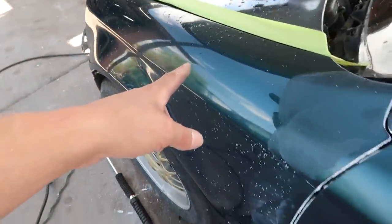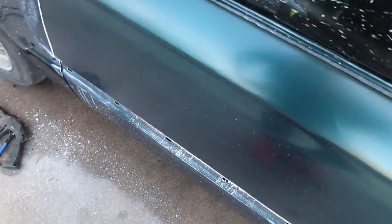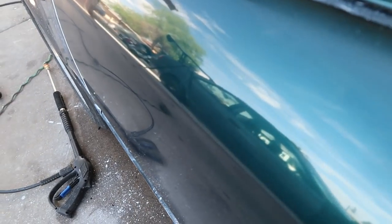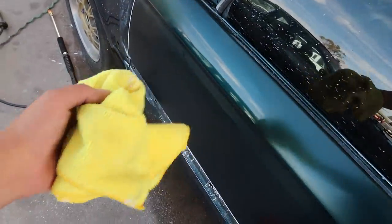So before I move on, because I've gotten that fender done, I went over it twice, and you can see how shiny it is. And you see this isn't as shiny, but I went over this twice as well, that's just because I haven't given it a good old rub down, you know what I'm saying? As soon as you rub it down, then you get that damn shine, bro, look at that. And that is literally step one, dude. This is a cutting compound. This isn't even a polishing compound yet. So, dude, this is gonna be amazing whenever it's done. I am so freaking stoked about this.